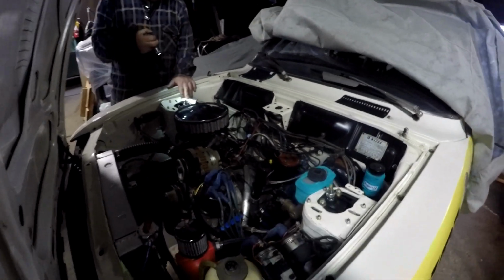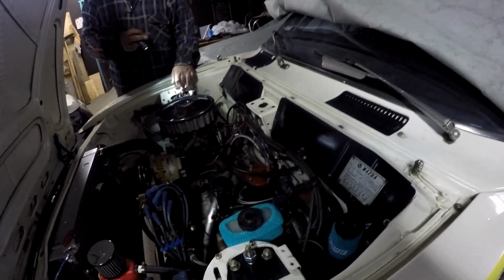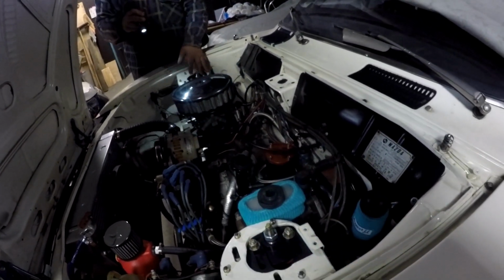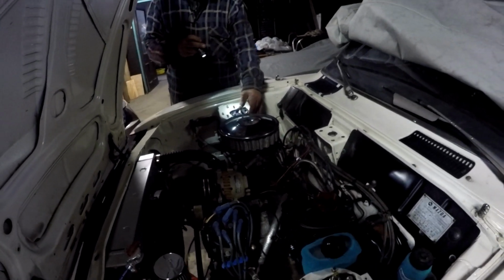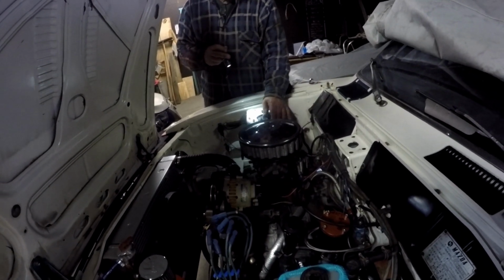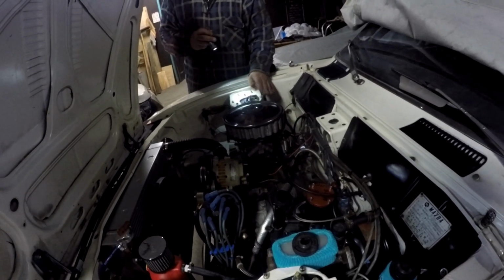Then these, I changed this. They didn't have it. They were using the original. I did all this right here. These are 200 SX camber plates like on that thing. They're basically perfect to get the diagonal and the setback for the caster, positive caster. That's why they're set back off angle.